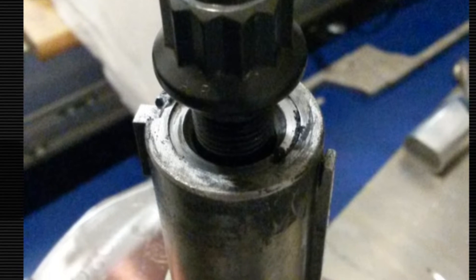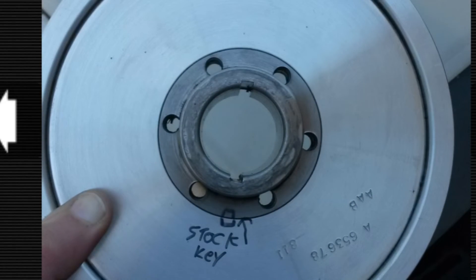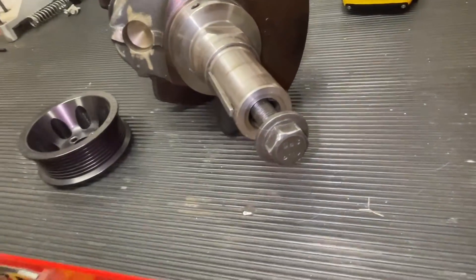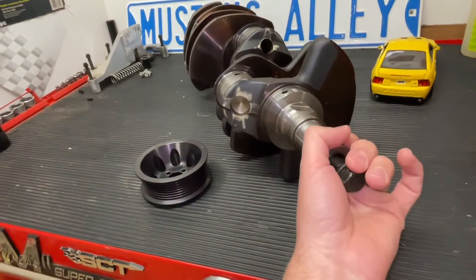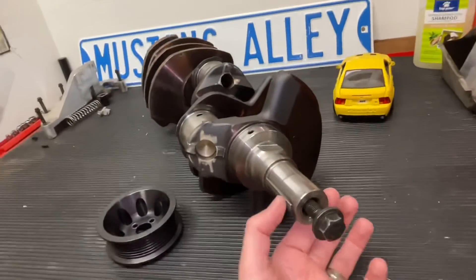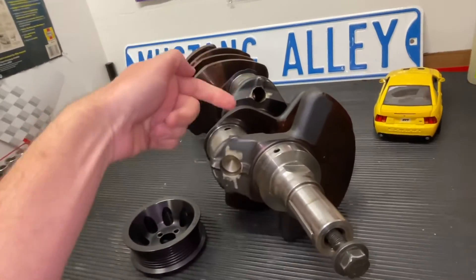Some people will go to a double keyway. Here's a picture of a double-keyed crankshaft from an 03/04 Cobra — you can see the two keyways. That's going to require modifying all the other parts to accept a double keyway. There's even controversy on that, because if you look at that second keyway, they had to notch it just to add it. There are thoughts that it might not be very strong because you're compromising the integrity by cutting into it. How much force it takes to spin that blower with the snout of the crankshaft is something major to keep in mind — the strength of the crankshaft will snap the snout.